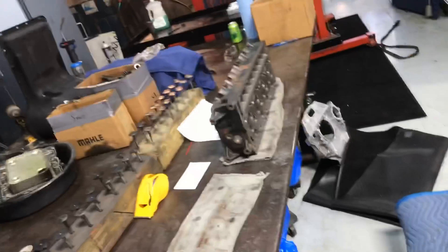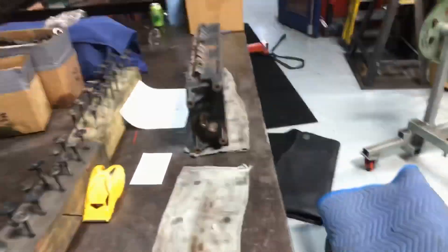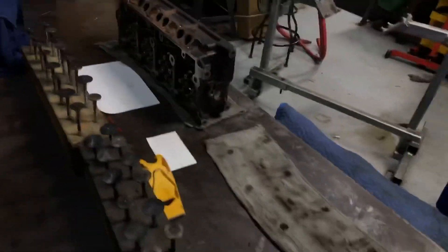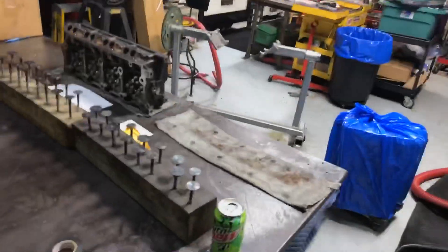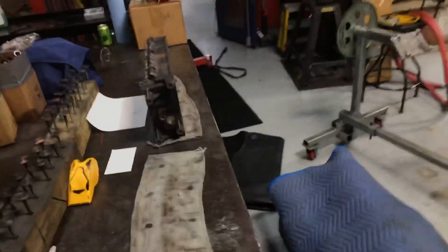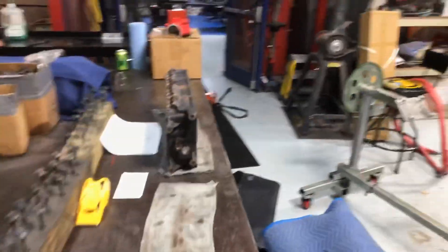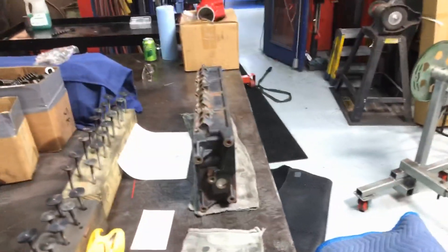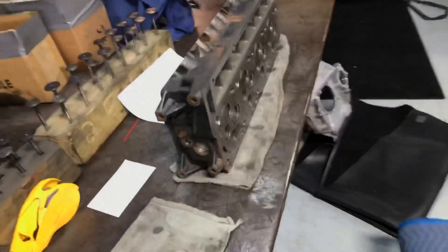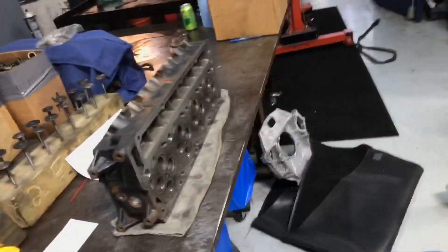We've got to check deck thickness — I don't think we've checked that yet. Worst case, we do a full valve job and get some bigger push rods. We can cut whatever we want off those cylinder heads other than the intake fitting. I know a lot of people talk about the intake fitting, but that must be a gas burner thing, because I pop them on all the time with no problem. But we need to get push rods ordered.